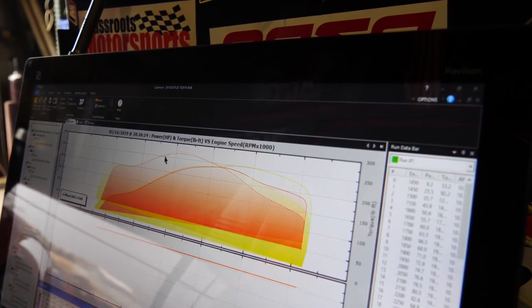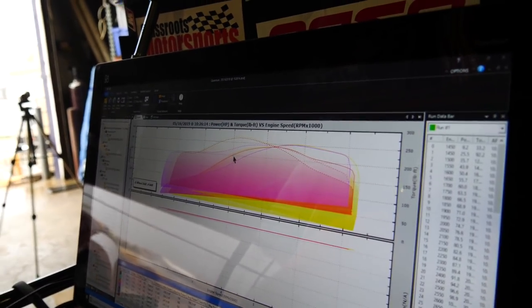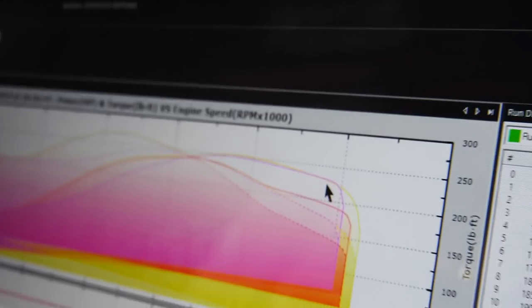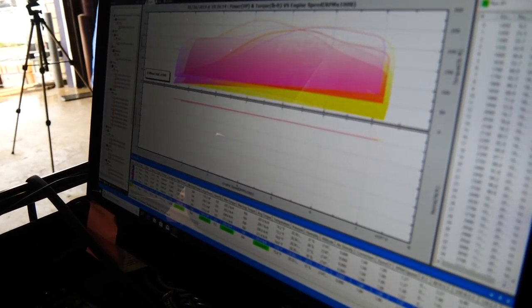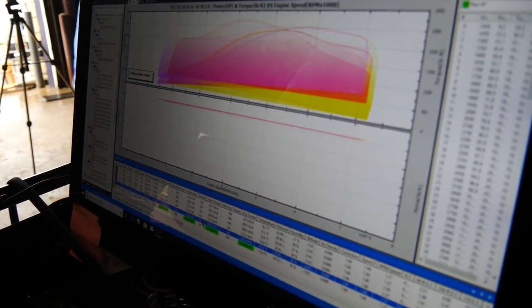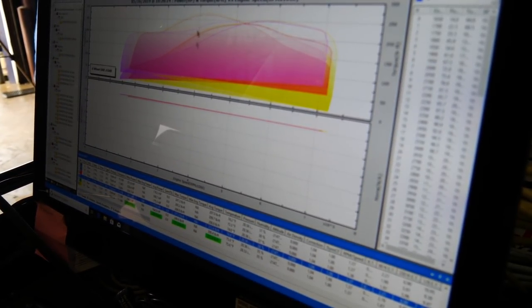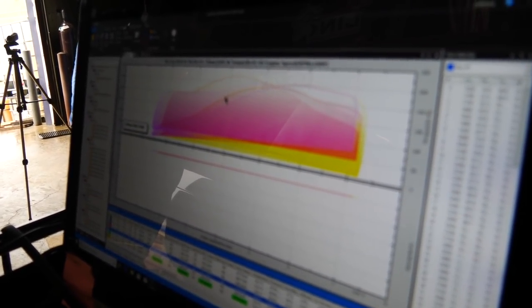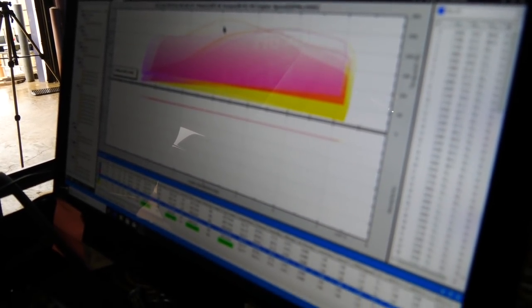So the orange line was when it wouldn't open back up at the top. All of this torque right here was glorious. Yeah, that's really good — you're not losing any top end. So what was the peak horsepower and peak torque for the last run? 251, which is about the same. And 270 in the middle here in the beauty area. That's huge. It's over 2,000 RPMs too — it's not just for a little bit. Yeah, it's from 3,000 to 5,000. That's sweet.